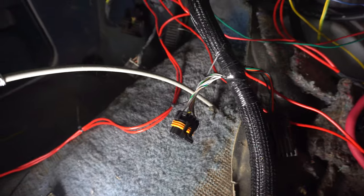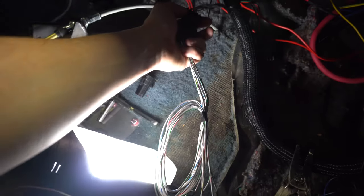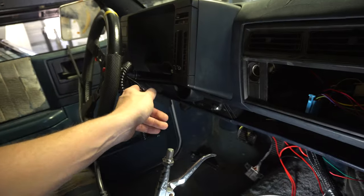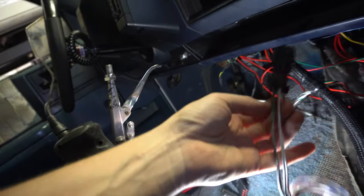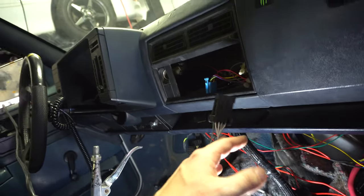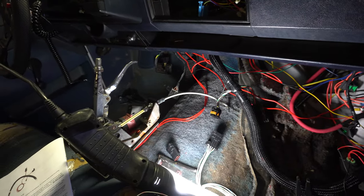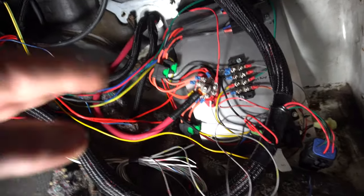Going to get this IO harness installed in the truck and run the starter wire. I went ahead and popped off the dummy seal plug and will go ahead and install the connector. All the other wires I'll leave underneath the dash so anytime you want to add something - like running the two-step wire - you just go under there, pull that wire out, connect to it, tie it back up, and you can add and take from it as needed. This is where you'd hook up the boost controller, nitrous solenoids, a two-step button, or a trans brake. This truck does have a trans brake but I'm not going to use it right now - we might play with it later. Man it kind of looks like a mess but it'll clean up pretty decent once I tuck everything up - everything is finally hooked up.